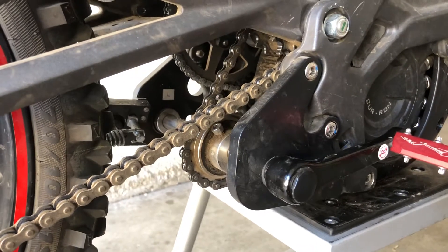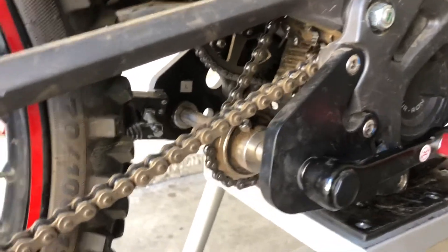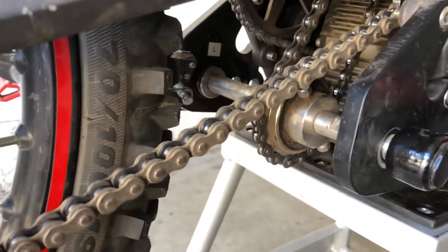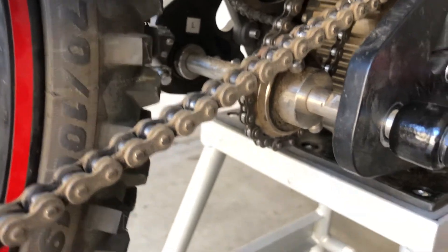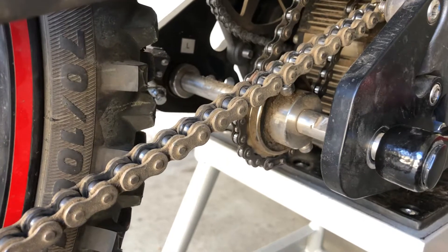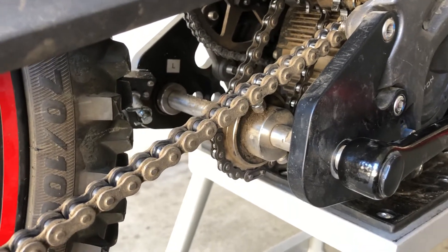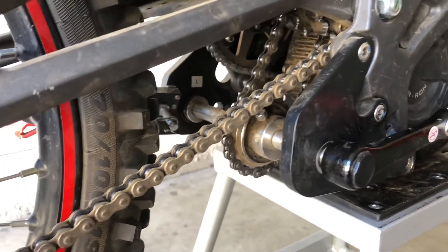That's one thing I really wanted to address because people have been reluctant due to rumors about chains breaking or build quality not being great. No one's a fan of the split sprocket, and on the older kits there's no flat spot. You can see a little mark where I used a Dremel and cut a small crescent shape so the bolts bite into it and it doesn't slip when I'm putting a lot of torque on it.